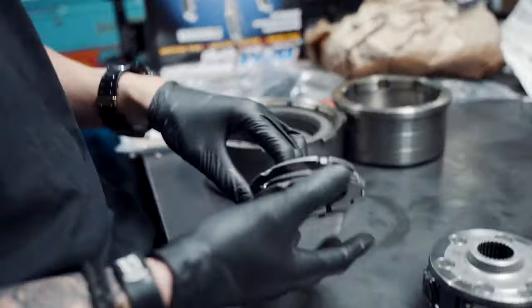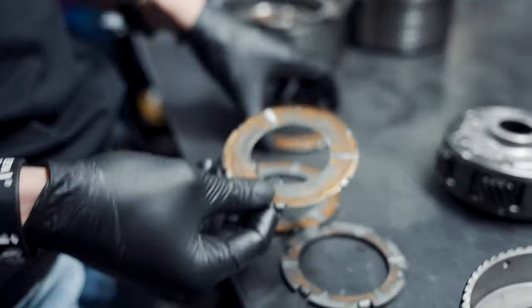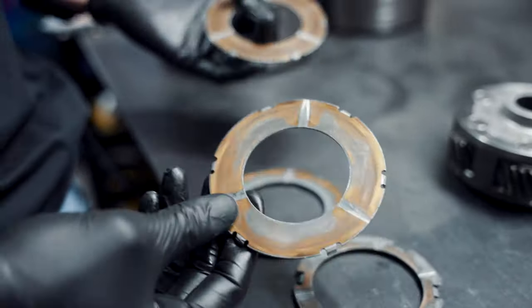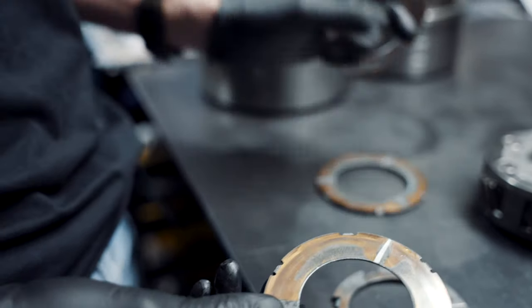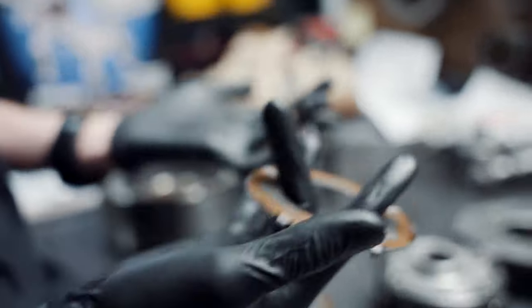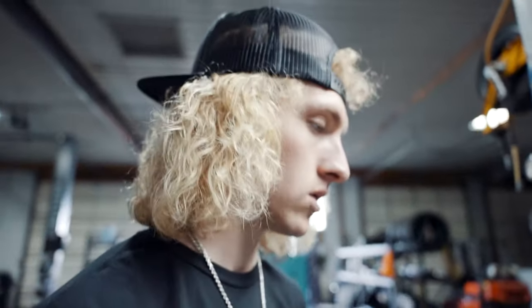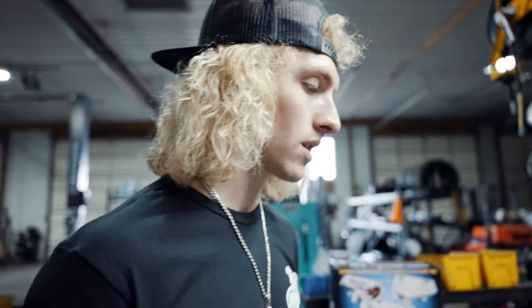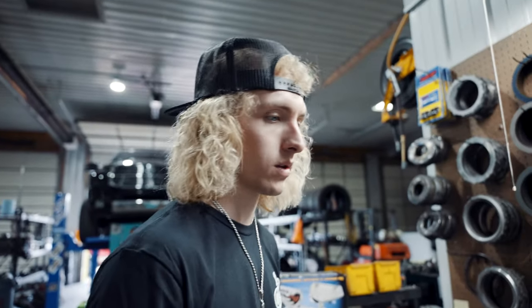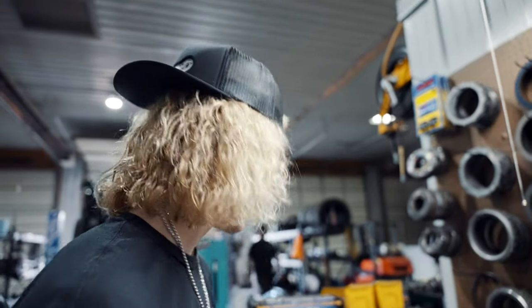So these are the thrusts from the 2006 that's on the rack. Wanted to show you guys. 70,000 miles on these thrusts. You can put rollers in them. You can do thrusts. There's only really two options. I've had really good luck with the thrusts in these transmissions. Lock shifts really hard, and that's what we're gonna do to this thing. We're gonna beat the balls off of it.